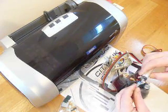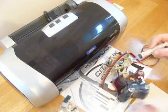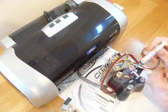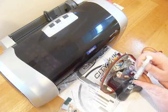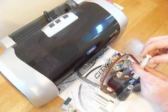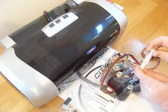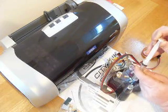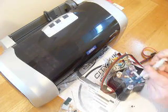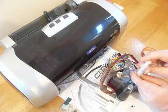Put the sharp needle onto the end of the syringe, and then we're going to put it straight through the large plug. You need to make sure that the needle doesn't touch the ink inside, and then we're going to draw back on the syringe to pull the air out. You need to do it once and then expel the air, then repeat the process,